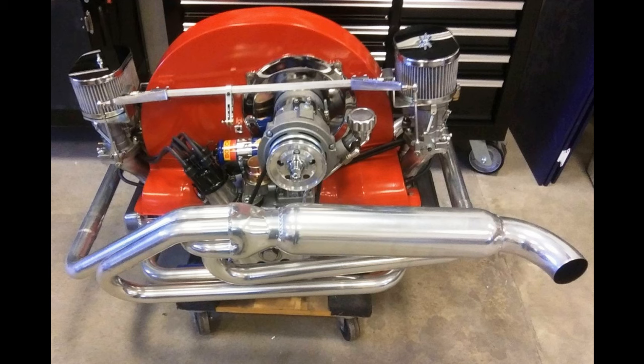The 1776cc engine is a complete rebuild utilizing new cylinders, pistons, rods, heads, and more. It's a dual relief block with an added free-flow high capacity oil pump and filter. It's been balanced and has a Crower performance cam. The dual IDF carburetors have been painstakingly tuned and jetted for this specific configuration. Its estimated 80 horsepower makes for some spirited driving capabilities in a 1,350 pound car.